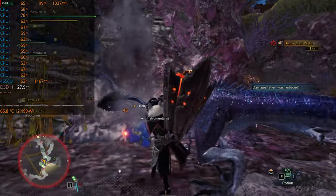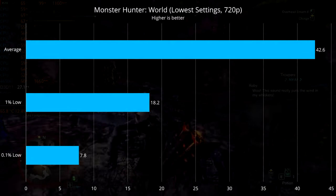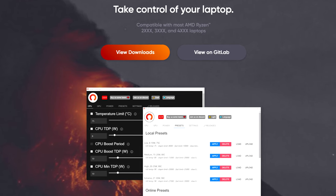Finally, Monster Hunter World — at 720p with the lowest settings, we average a very playable 43 FPS with a 1% low of 18, and a 0.1% low of 8. Obviously these numbers aren't even close to rivaling gaming laptops, but they're respectable nonetheless, especially considering the main problem of the X395 was its graphics performance. Back then, when the old 3500U hit its 17-watt TDP limit, both CPU and Vega 8 graphics were downclocked, which heavily affected gaming performance, and it could only be addressed using Ryzen controller to manually adjust the TDP to 27 watts, which worsened temperatures significantly. However, it seems like Ryzen 4000 series CPUs use an algorithm to regulate power sharing between the CPU and GPU. In games, the 4650U allocates a larger power budget to the Vega 6, whereas the old 3500U would probably just split them evenly. In fact, there's no discernible frame rate difference for when the CPU is at its 18-watt limit or its 15-watt limit, which is great to see.